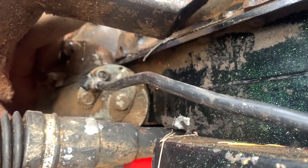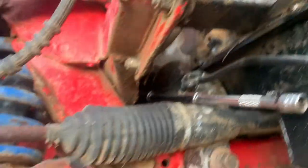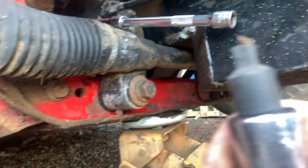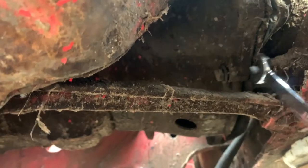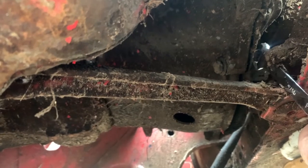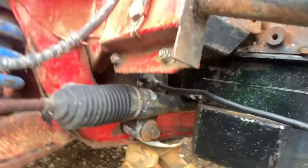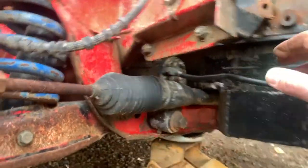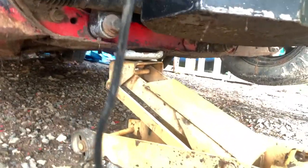We're crawling underneath the car to loosen up the starter bolts. The starter bolts are fun to get to, especially when they're crusted with mud and oil and grease even after pressure washing the engine. I could not break one loose until I got a breaker bar on there. They're all 3/8 bolts, so a 9/16 wrench. After pulling the bolts out, I found I have to pull the motor mount and jack up the motor to get the starter out.